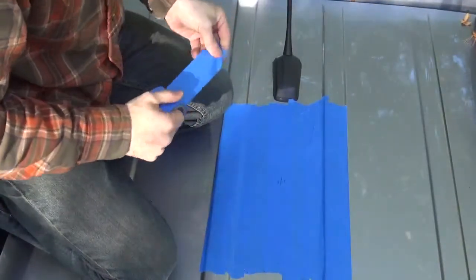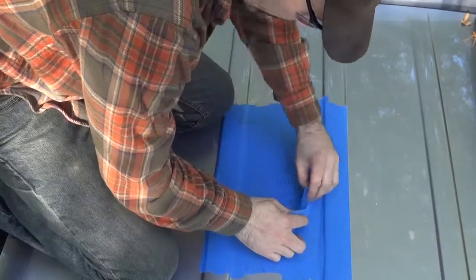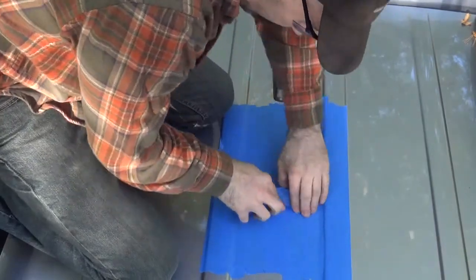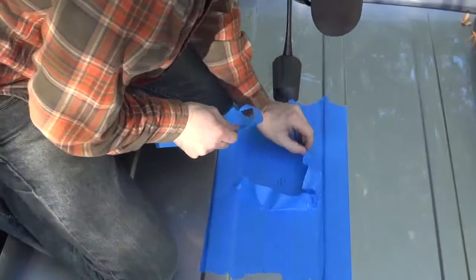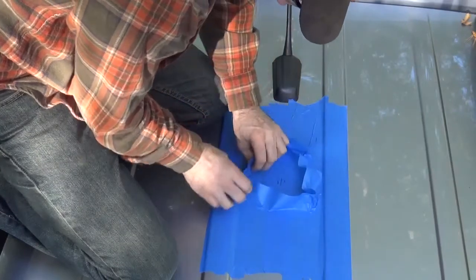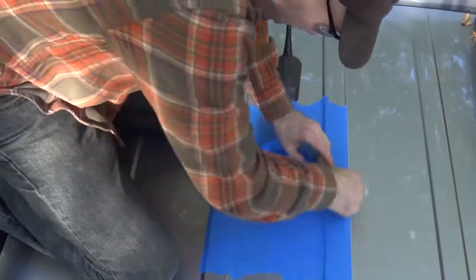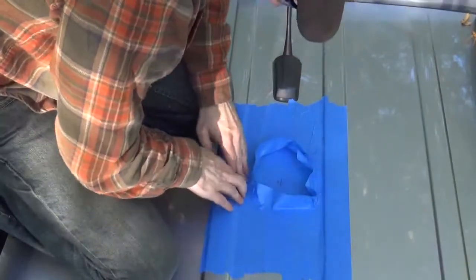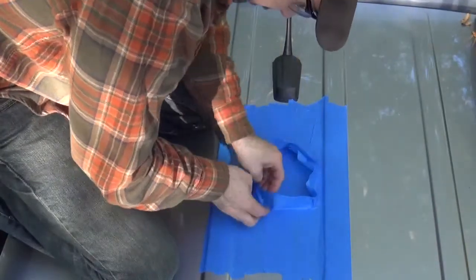Okay, back up on the roof, we have our marks. What I recommend you do is build a tape dam, a round circle around where you're going to drill. And this will stop chips from scattering all over the place on the roof. See, the thing with steel chips is you'll find that you miss them when it's too late, after it's rained, after it's snowed. So having some type of barrier to stop as many as possible certainly will help. Get your hearing protection and your eye protection ready, and of course your drill, and we're going to drill right on our center mark.